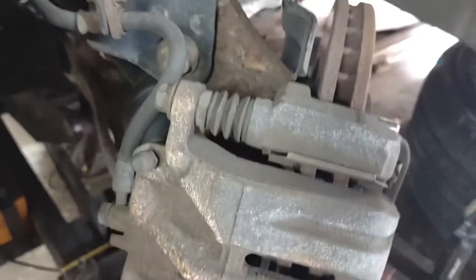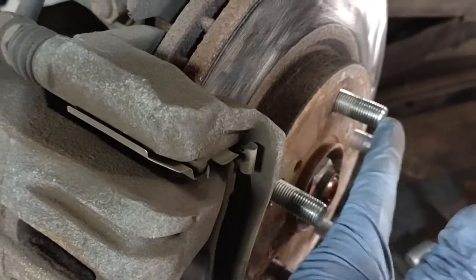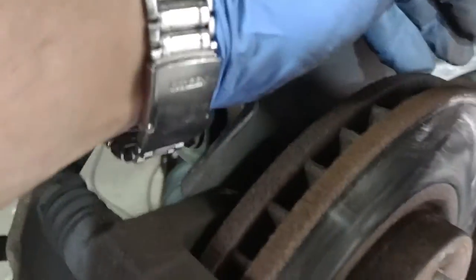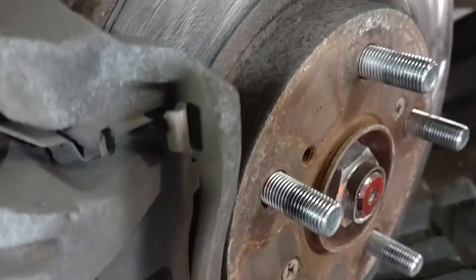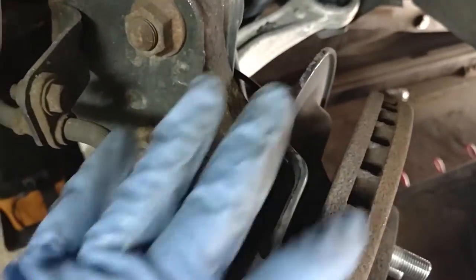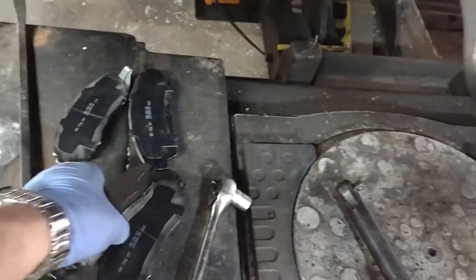Also make sure the brake fluid is clean. Make sure the wheel bearing is not wobbling and doesn't have play in it — that also affects the brakes. Make sure the brake disc doesn't have too much rust on it. If it has too much rust, it's going to cause some noise while it's turning, especially after you put new brake pads on the car.